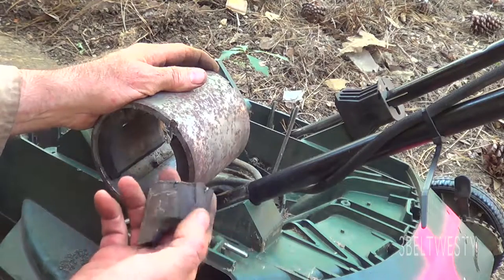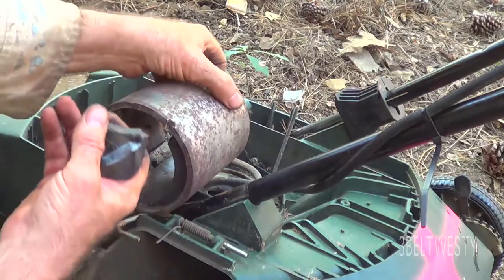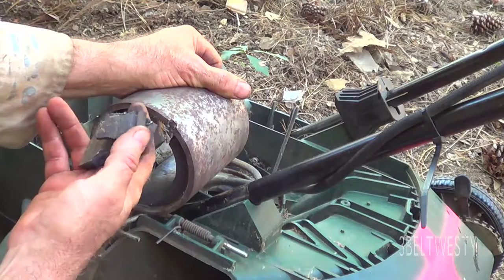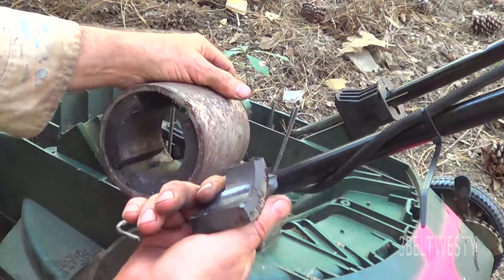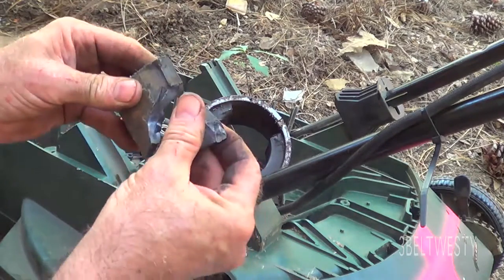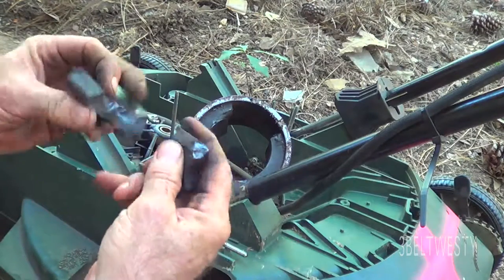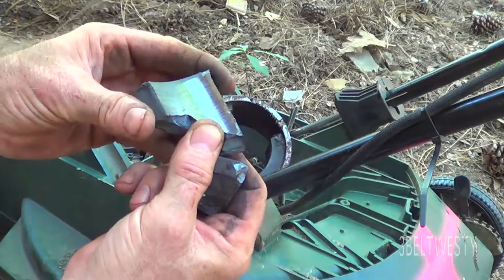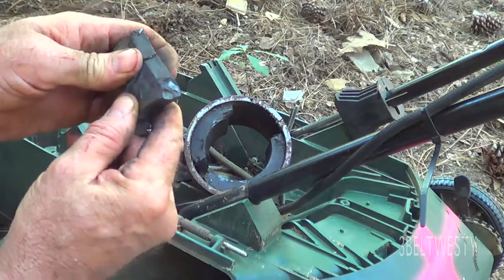I've experimented in the past - you've got to use a really good epoxy or something, and use a C-clamp and some type of wood to hold that in there. It's really difficult to do because these pieces that have come off don't like to go back together where they came apart. You can see here where it's been rubbing on the armature. That's a ceramic magnet.